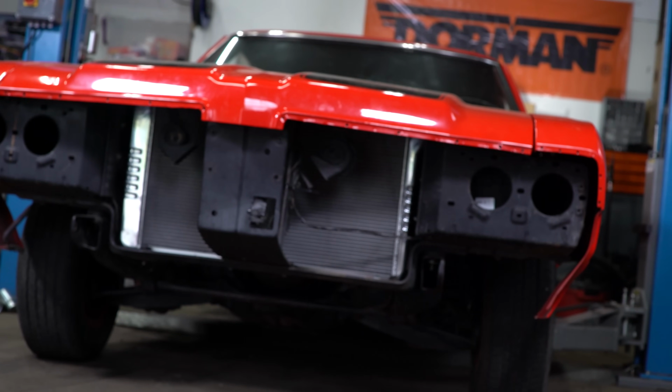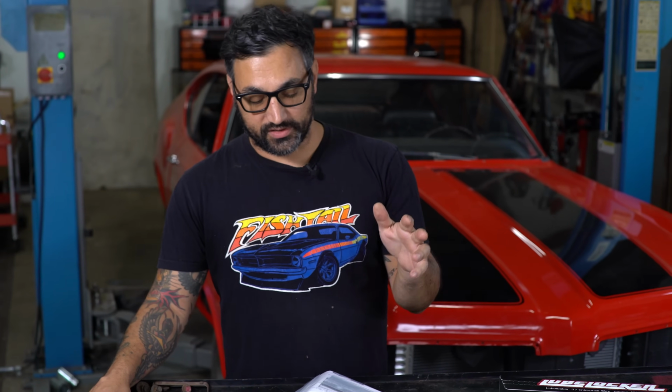All right, so my 1970 Cutlass has a 4-speed overdrive transmission swapped into it, a 200 R4 that would have come in like a Grand National or a Hurst Olds from the 80s or Monte Carlo, any one of those things. And it's a great transmission. It's a 4-speed overdrive, tight gear pack. But it needs to have a signal or a power sent to it to lock up the torque converter, like cruising on the highway and stuff.